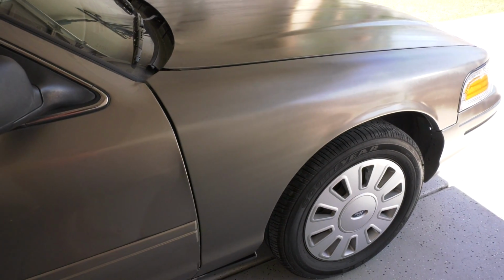And it's also a lot harder to get that horizontal surface that's taking direct light to look flat, I guess you'd say. And I can probably hit it a little bit more with sanding, but if you did a whole car with it, you'd be sanding forever. And I'm not sure that would be the appropriate way to handle painting a car. But if this car only required a fender, the bumper, and the header panel, and the hood wasn't involved, that all turned out really great. I'm beyond thrilled with how it looks, actually.